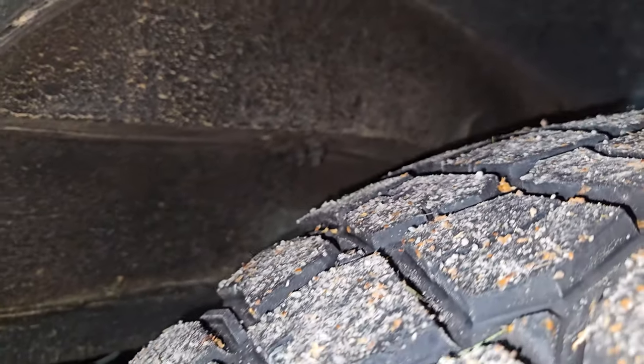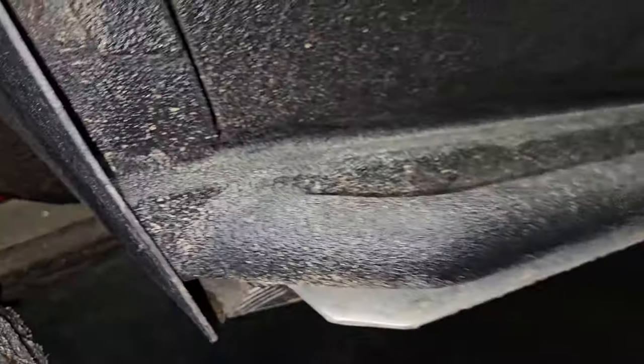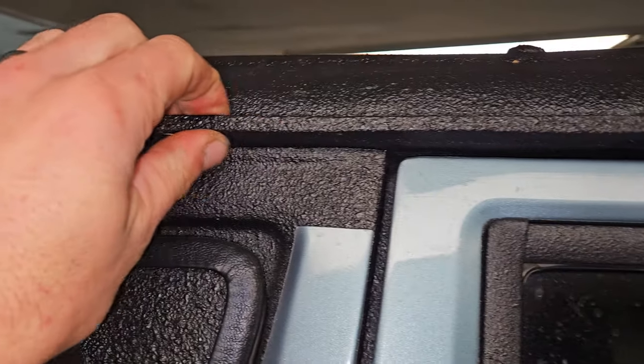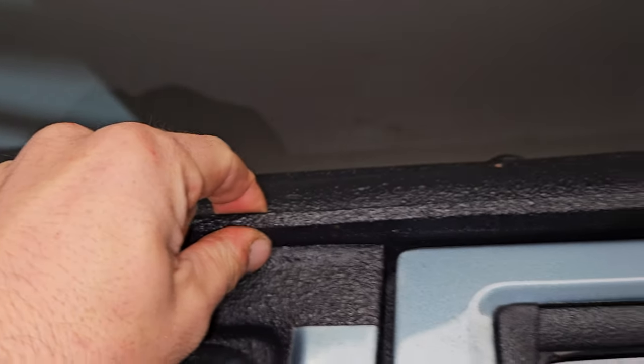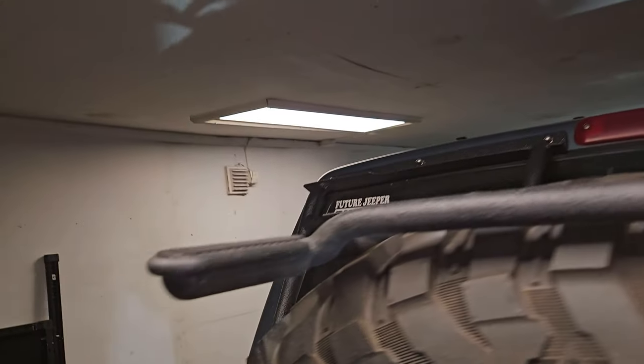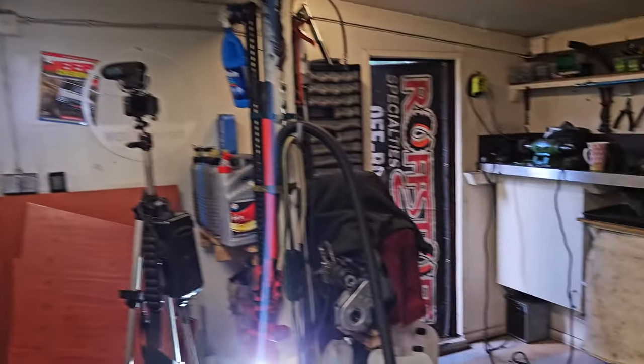This is obviously my diesel Jeep, and you can see exactly what I mean. No seams anywhere. They've all gone. Obviously, it's been box rockered, so that seam's gone there. And the drip rail is now seamless too, because that's one solid piece of U-channel with like a 5mm wall running along there. You can see the original piece of metal there, welded permanently all the way along that new piece of U-channel. So making the vehicle seamless literally stops starting points for corrosion. And that'll be what I'll be looking to do on the Renix whilst I'm working on it.